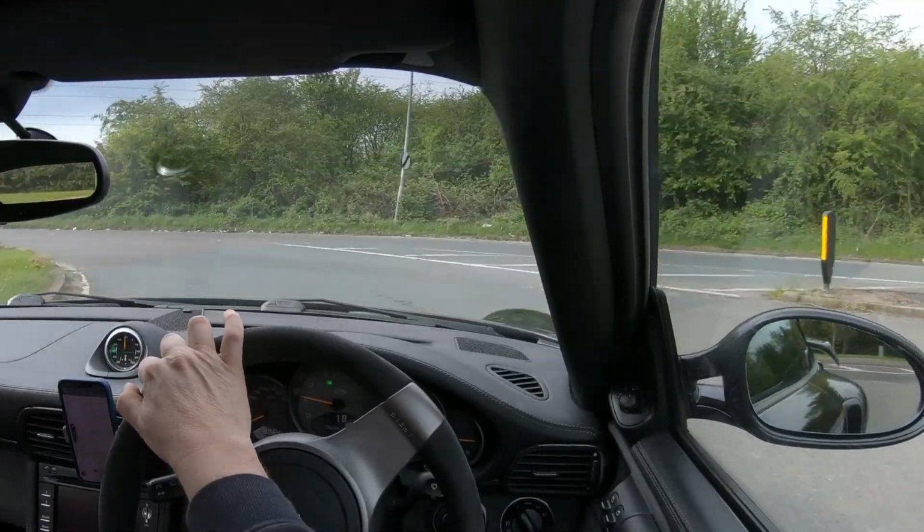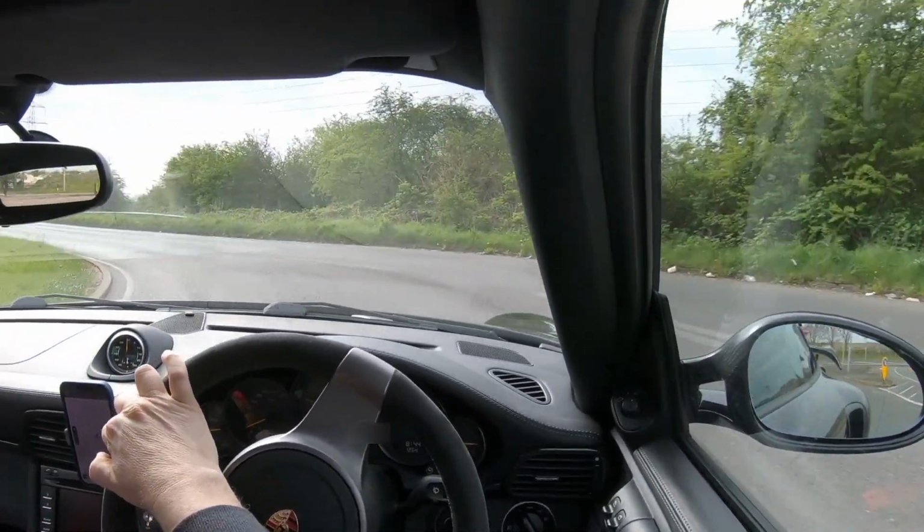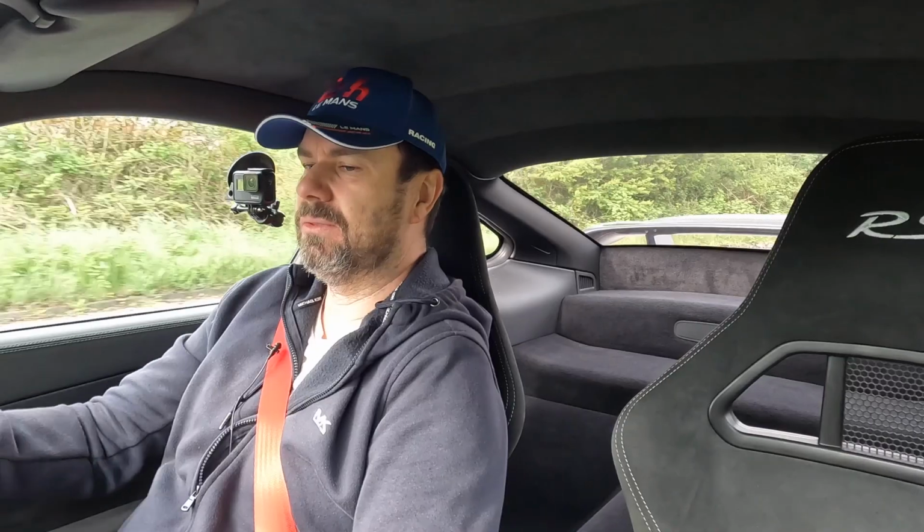And why is that? Well, a few reasons really. First of all, out of the factory, the car comes with an active suspension. You have a button, you press the button and the suspension hardens and softens. Well, this Öhlins suspension is a passive suspension, which means it only has one setting, and that button is now not effective, it's not connected. So I want to have that back.